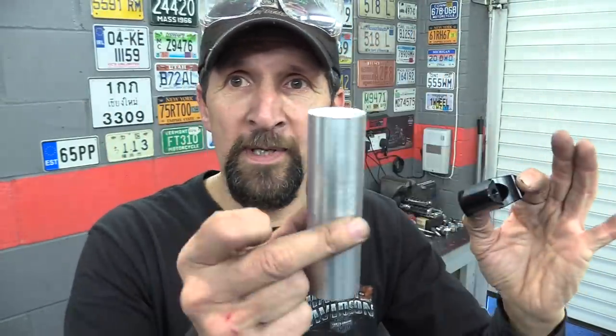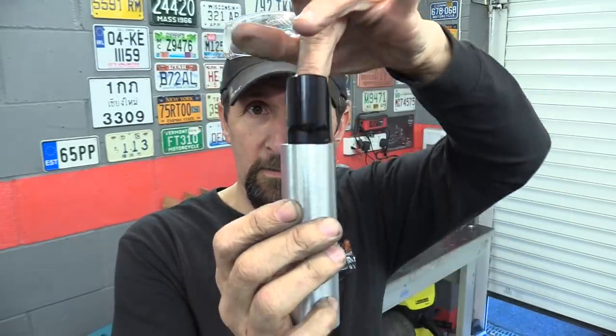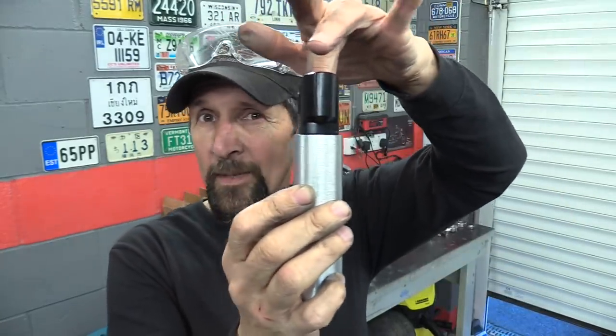That's my clamp that I'm going to use, black anodized billet aluminium, and that's my piece of bar stock. That's 34mm, that's 28mm. Well, it's 28.09 to be exact. That's its exact diameter there, so that when I put it on, if I machine this down to 28.09, and when I put it on top, it'll look cool because it'll be exactly the same diameter.